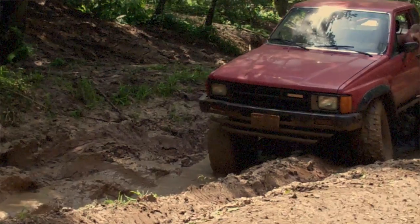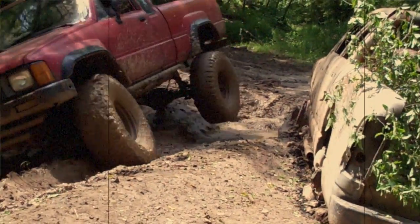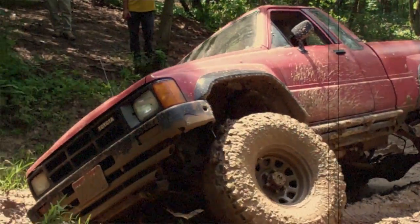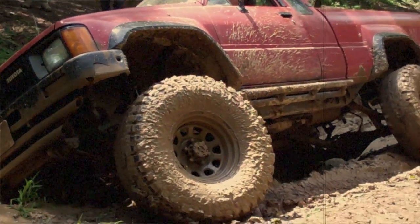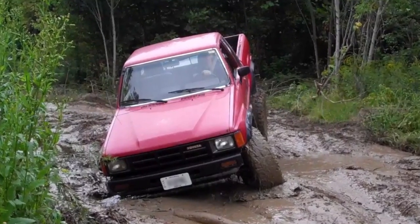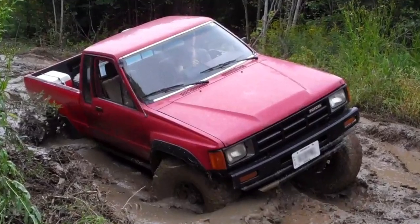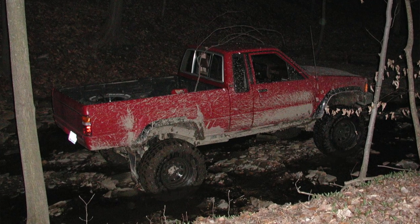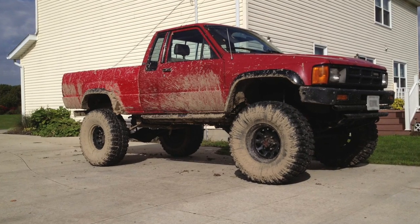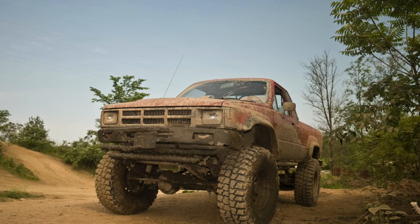As far as driving it in the nice season, which is the only time I recommend, you really gotta be careful about getting it in the mud. I've taken this truck through some pretty deep mud and always afterwards I make sure I clean it, because when you have mud on a metal surface that mud is going to hold moisture. That mud is going to stay damp a lot longer than water just on the frame by itself.